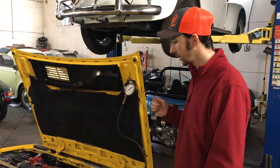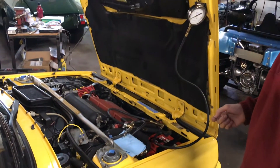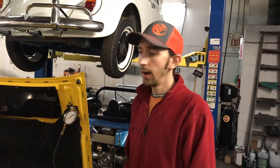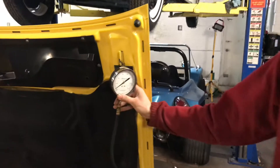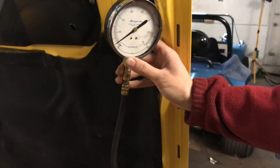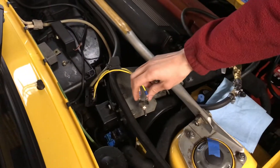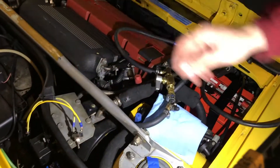What we're going to do right now is put together a quick test of the fuel pump itself. Fuel pump pressure on the Lancia Delta Integrales should run about 4.5 bar on the weak side and up to 7 bar on the high side. If you're between those ranges, you're healthy with your fuel pump. If you're below those ranges, you're suboptimal — you should replace the fuel pump, and that's probably the source of your problem. We've got our fuel pressure gauge connected up. This one does PSI but we just convert it to bar on our own. We also have our jumper relay in place. Check out the first episode to see how to install the jumper relay and which pins to connect to.